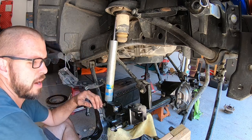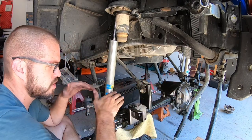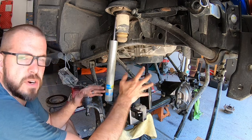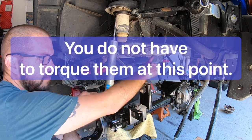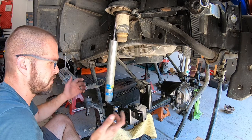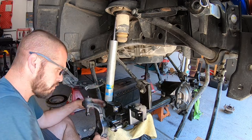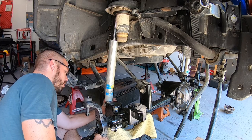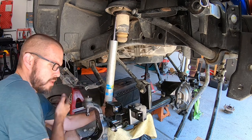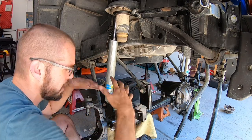The ultimate Dana 44 gets slid under the Jeep using casters I built with two-by-fours and jack stands — makes it really easy to slide it around and get it under the Jeep. Once it was under the Jeep, behind the track bar, the first thing I did was put a bolt through each of the upper control arms. That way when we rotate the bottom of the axle to line up the lower control arms, you don't have to worry about the axle going anywhere — it's almost like you have a couple of extra hands holding it.